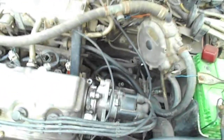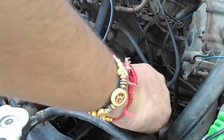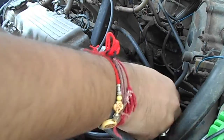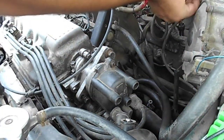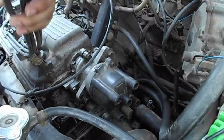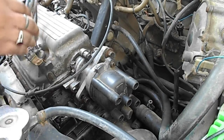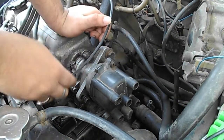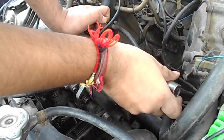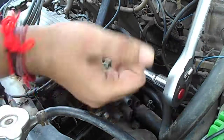We will solve this today. First of all, we remove the spark plug wires — just push them out from the distributor. This is the main wire which comes from the electric coil — just keep it aside like that. Remove the other two as well and keep them aside. So now we have a clear area right here. Let's start removing. We need a 12mm socket with an extension and ratchet to remove it.